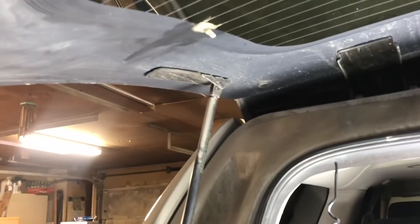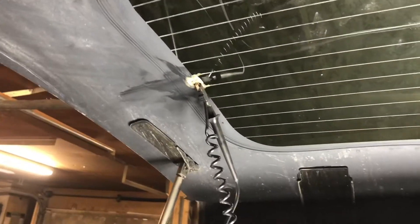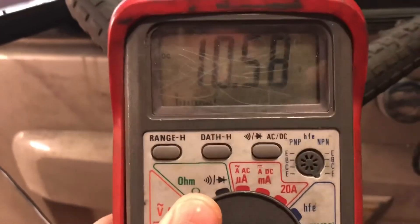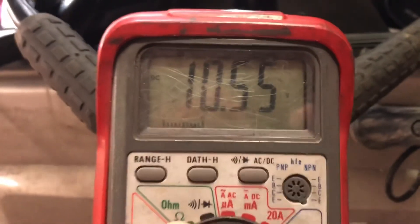After it's all put together, we're going to hook everything up, double-check continuity, and then actually activate the element and check for voltage — make sure everything's purring like a kitten. And we've got our repair finished. Continuity exists after the repair and we officially have voltage across there. There's a little bit of a drop, which is indicative of the resistance, and we're good to go. The next big test is of course getting it to ice up and getting some melting going on — over and out.